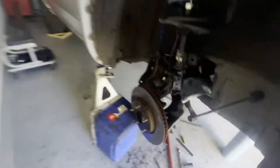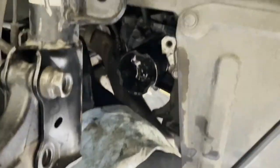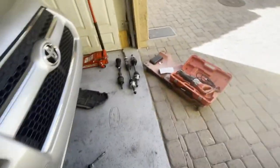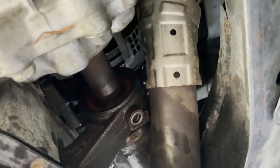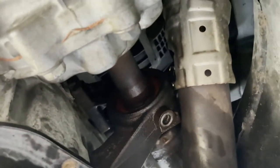Next day — this escalated very quickly. The boot came completely off the axle, but the big problem is that the bearing on the axle is seized in the bracket. This is why I didn't find any how-to videos on how to do it — everyone says that the bearing just seizes up in the bracket and it makes it impossible to get the axle shaft out of the transfer case.